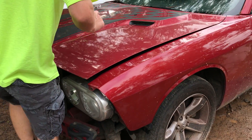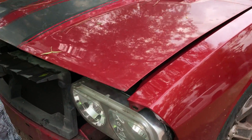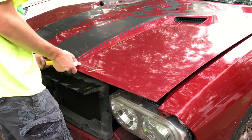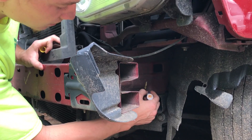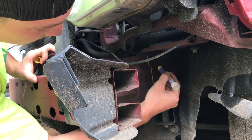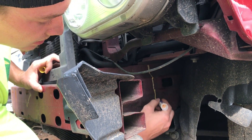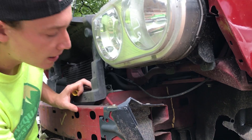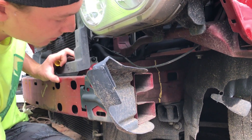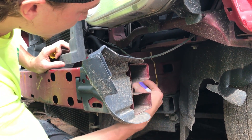Go ahead and pop the hood to show where we need the frame rail. There's a good frame around here that's undamaged, so it's gonna be perfect for us. We're marking this frame rail about right here — that's about where we need it. Not that much needed on that car because it's just the tip that got bent pretty bad. We're gonna splice it in just like the Mustang and we should be good. I went ahead and put my mark.